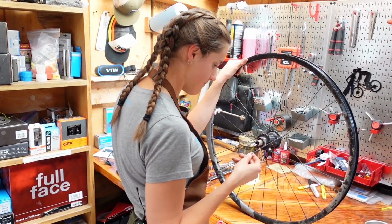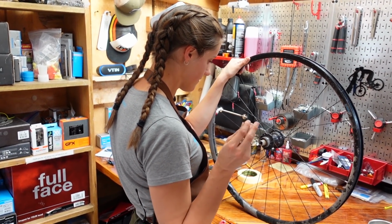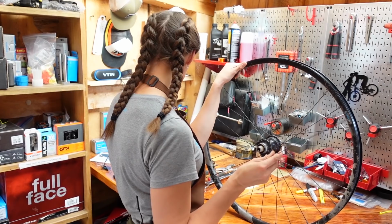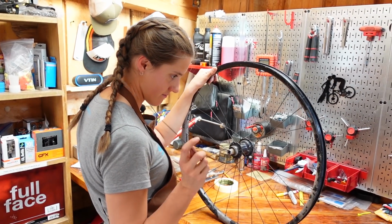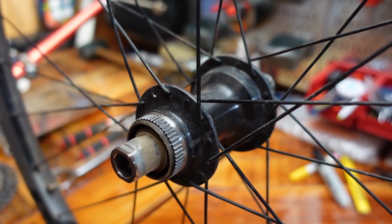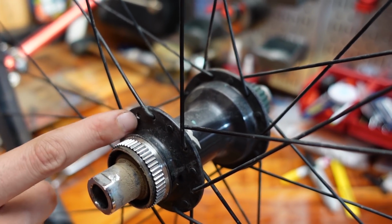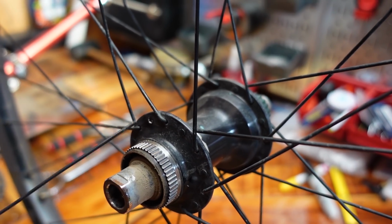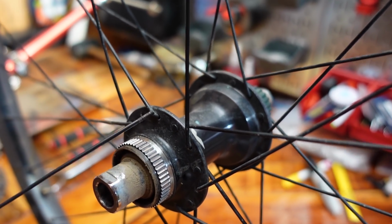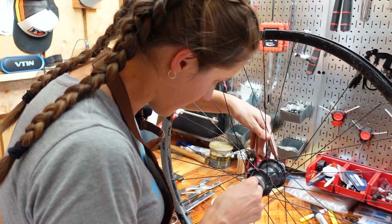This is something that we learned this time, is that you should measure your spoke after you remove it from the wheel, because we had purchased the wrong length spoke. Now we have the right length spoke. It's fairly obvious how this goes in, if you're willing to think about it for a second, is that obviously this spoke is going to go in from this direction because it's going outside, inside, outside, inside, outside, alternates. Inside. In it goes.